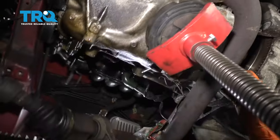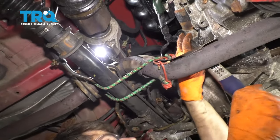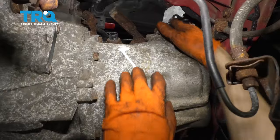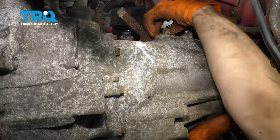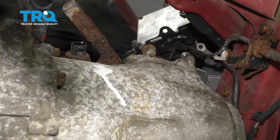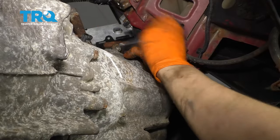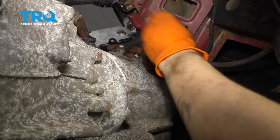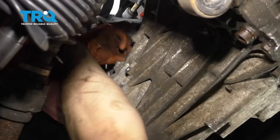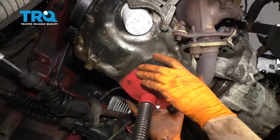From underneath, I'm going to put in the motor mount bolt — it's not going to line up right away, but when I push the transmission over it does line up. I'll do the same to the rear. Let's snug them up — I'm not going to make them very tight yet, just close enough so that I can remove my engine support. Now with the transmission mount bolted up, I can remove my support. Go ahead and put the other two engine mount bolts in — start them by hand so they don't cross thread. That one in the front and this one in the back.